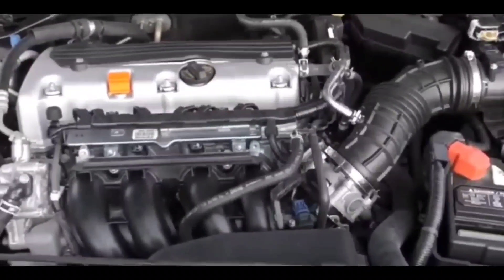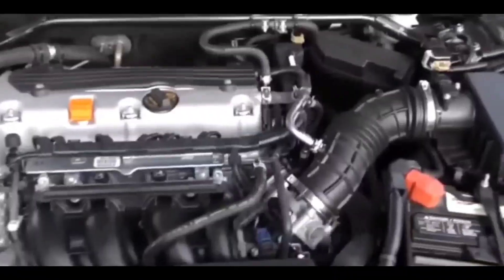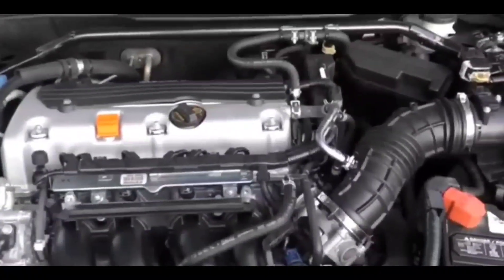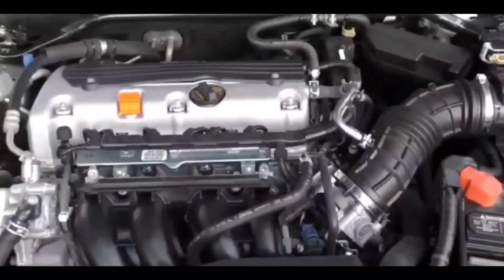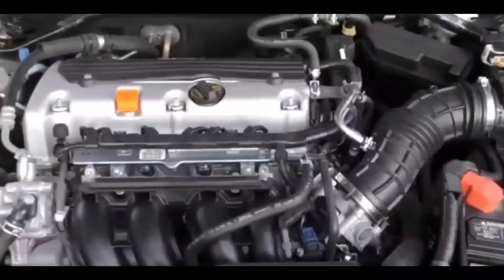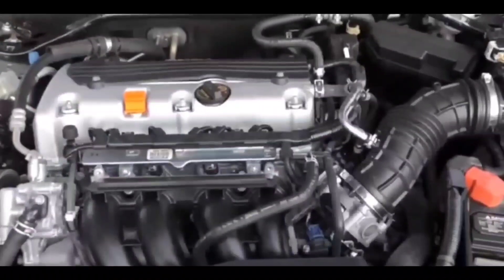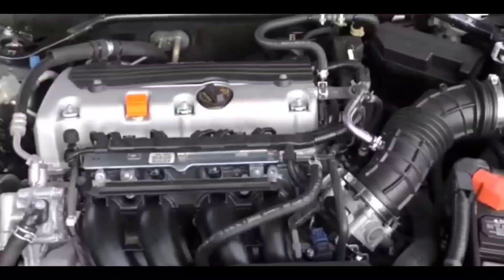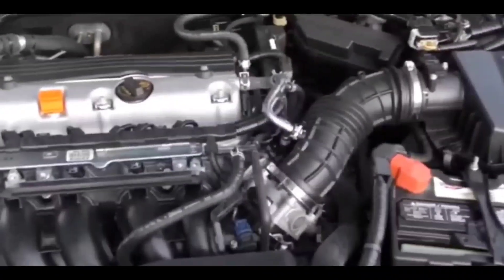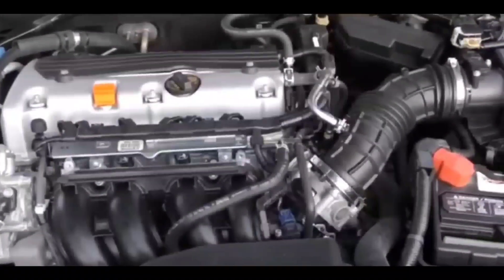My next step was I went and checked the fuses and the relays. All the fuses looked good. I didn't have a fuse tester on me, but I looked at the fuse box to make sure nothing looked brownish or burnt. None of it looked burnt, I didn't smell any kind of burning coming from it. So I was thinking maybe it's the fuel pump or the fuel pump relay — one of those things might have gone out.